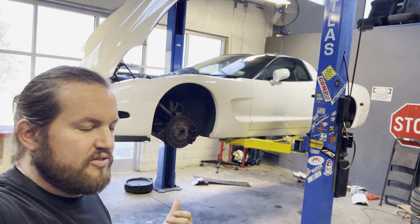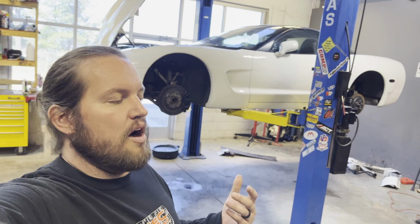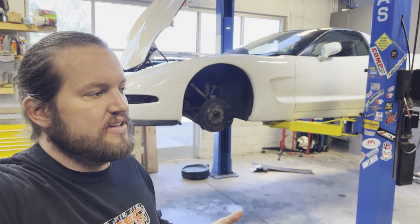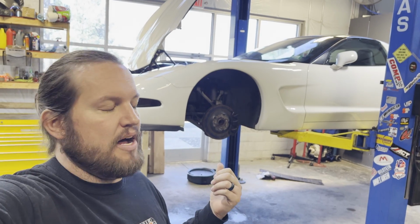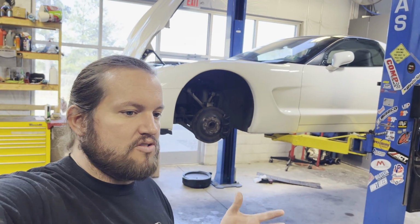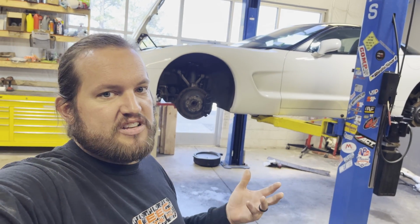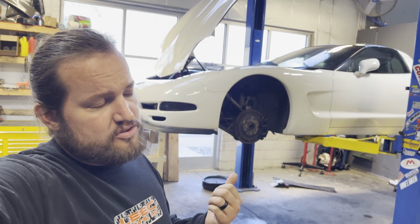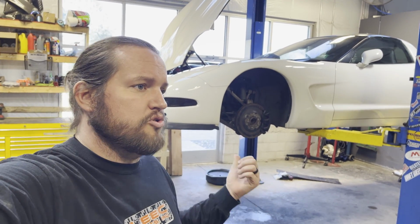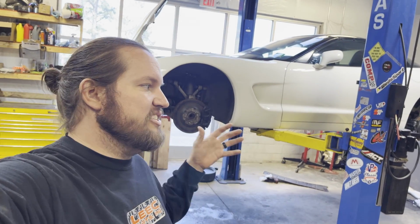So this thing fired up for the first time. It was not quite what we were hoping for, but we were kind of anticipating it given that it has an LS3 style 90mm throttle body on it. There's a couple things on this that we knew weren't really going to be 100% happy right out of the gate. With us swapping to the C6 headers on this car, we have to get an O2 extension for it, so it's running down one O2 sensor also. Needless to say, though, we're very happy with the fact that it does run.